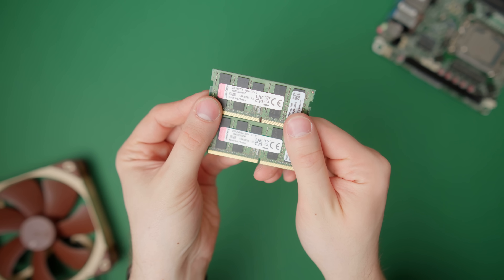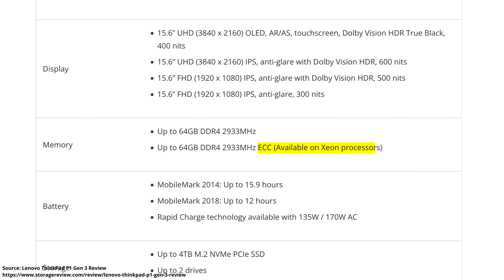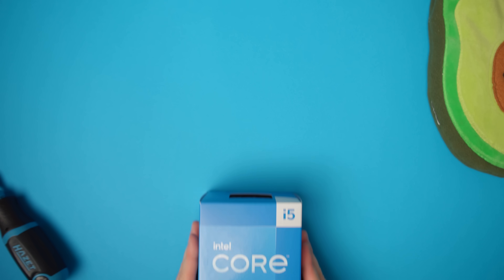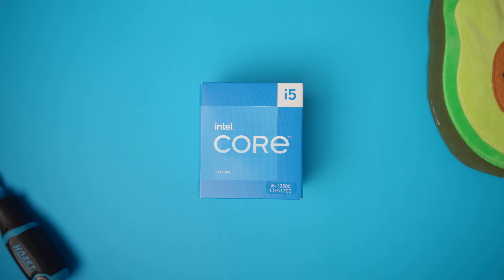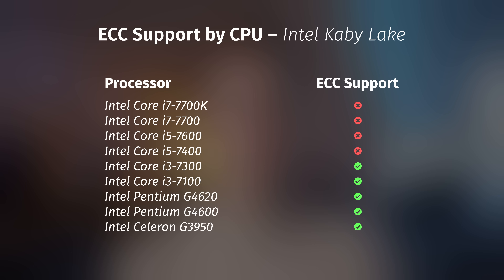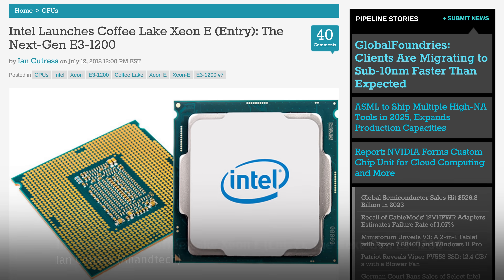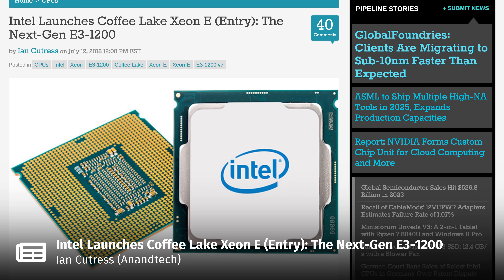I've paired this motherboard with two 32GB SO-DIMM sticks of unregistered ECC memory. ECC memory in this form factor does exist, since plenty of workstation laptops actually come with ECC support. For the CPU, I went with the Intel i5-13500, which is the lowest-end CPU in the lineup that comes with ECC support. For years, Intel only enabled ECC support for low-end consumer SKUs like Pentium, Celeron, and i3, which was enough for modest home server builds and NAS boxes — but if you needed more performance, you basically had to buy a Xeon CPU.